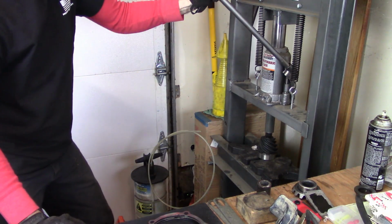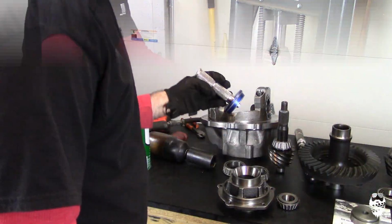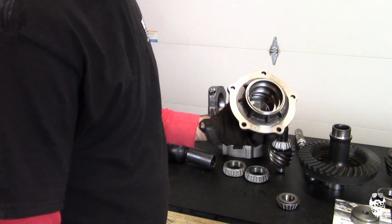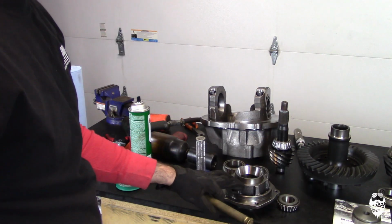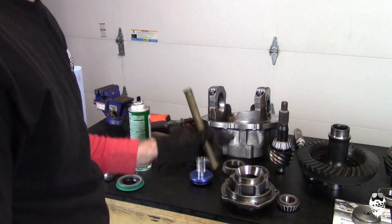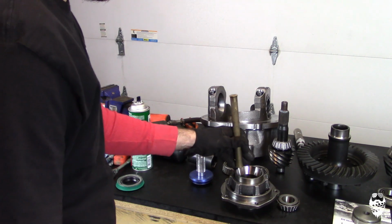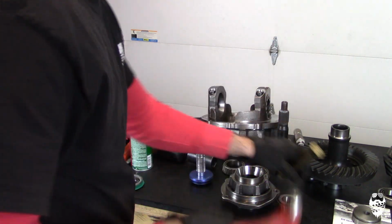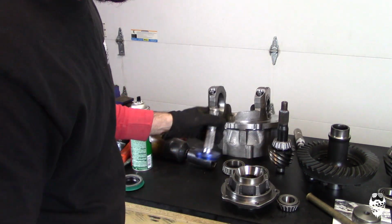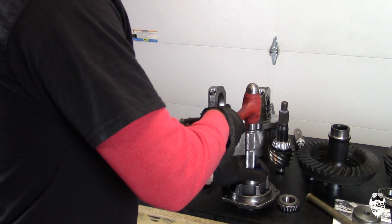And you'll know when it's all the way on because you can't do it anymore. Next on the list, going to put our bearing races into this pinion housing. So typically I prefer to get these races, anything with bearings, anything started by hand, like with the brass drift and everything, before I start with this, because this might get a little bit cockeyed when you're trying to pound it in. But once you get it started with this, then it goes a lot easier with these.